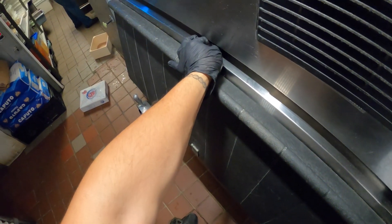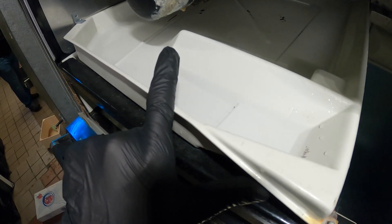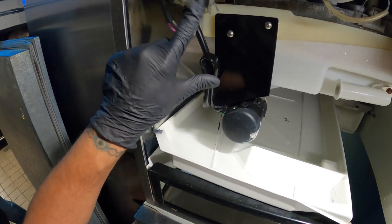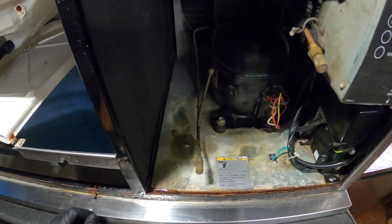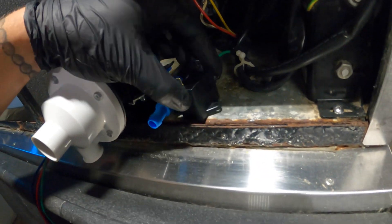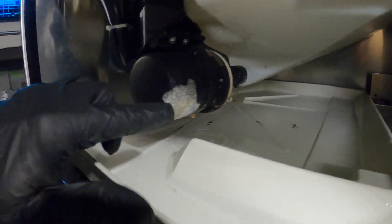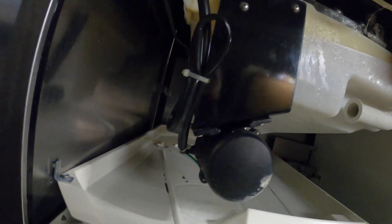There's actually a screw in here this time, let's loosen that up. We're going to be making some repairs today. As you can see, this pump is in very bad shape and it's actually leaking. This solenoid valve — our fill valve — is actually leaking by; we noticed that during our last maintenance. I have a new OEM pump from Hoshizaki, a new fill valve, and a capacitor for the pump. You can see that drip — maybe the gasket went bad — but just because of the condition of how everything looks, they want to change it, so it's definitely time.